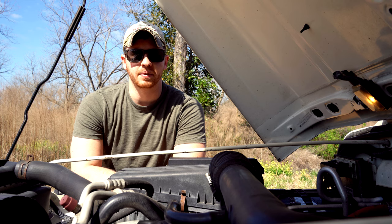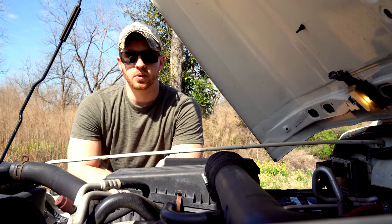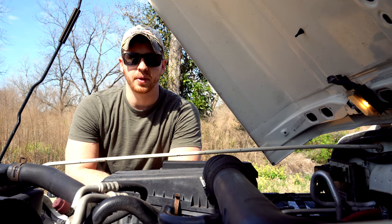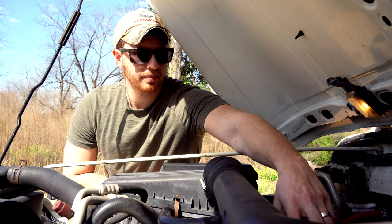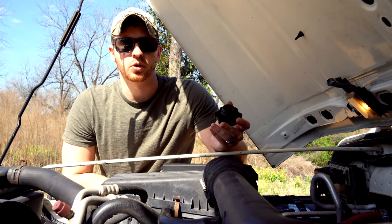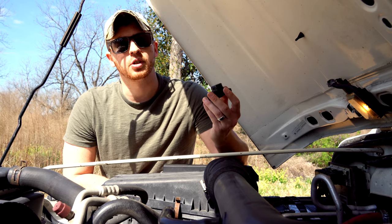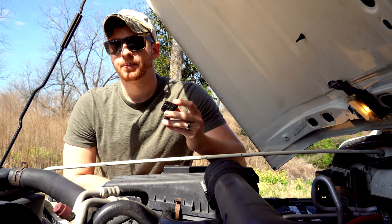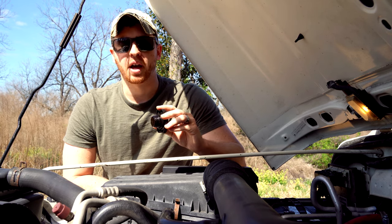This section can apply to buying any vehicle, but I'm going to show you how it looks on the Jeep. When looking at a used vehicle, you really don't know the health of the engine unless you run a compression test - but chances are you're not going to do that. So a couple of quick things: take off the oil filler cap and look for any sort of foam on it. If there's foam, that might mean there's coolant in your crankcase and you probably have a blown head gasket. The second thing - smell the oil cap. If it smells like gas, you have a leaking injector or something else wrong with the intake manifold, possibly the valve train. You're probably going to want to back away from that Jeep.